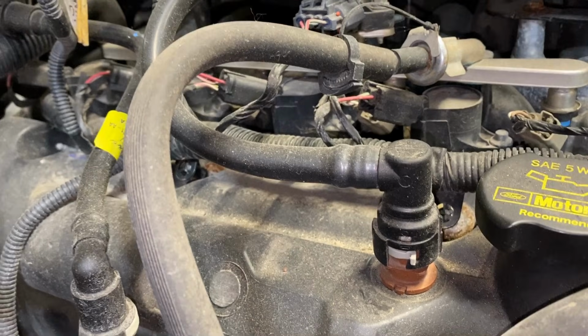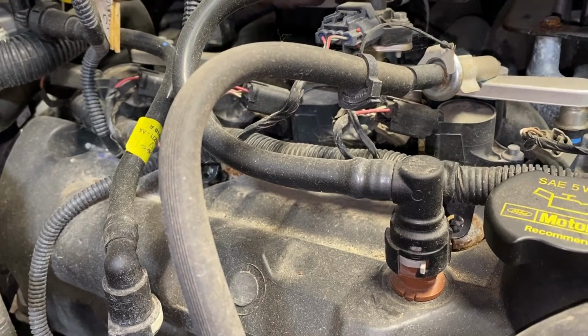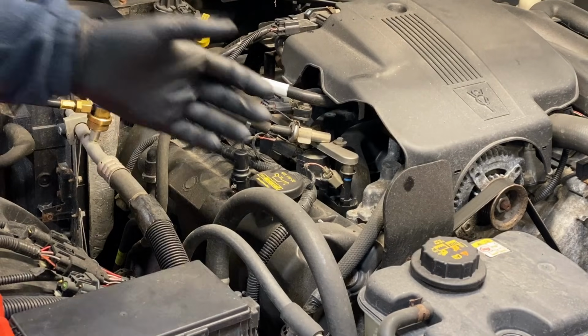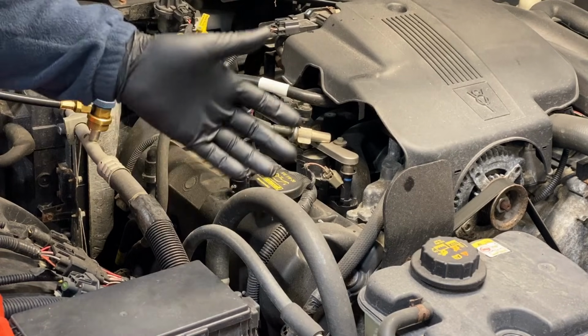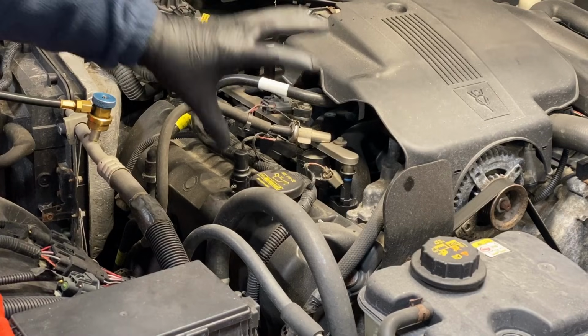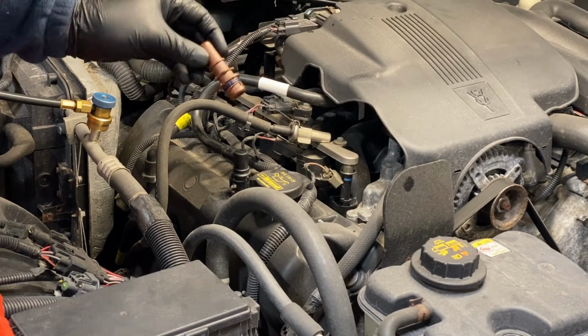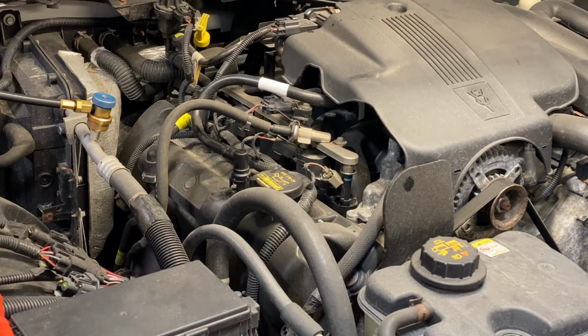Wow. Yeah, so sure enough. All right, so the customer approved repairs. I mean, how could you not? The accumulator is probably the cheapest part you can replace in the AC system, and for an engine knocking noise, a $6 to $10 PCV is the cheapest part you can probably change too.